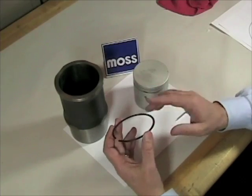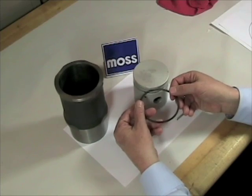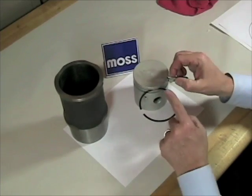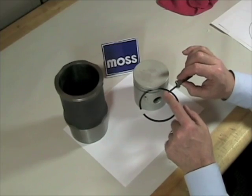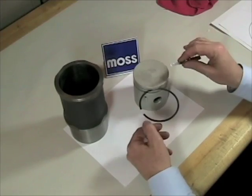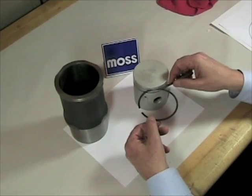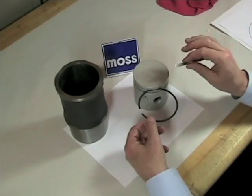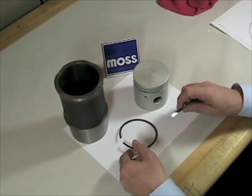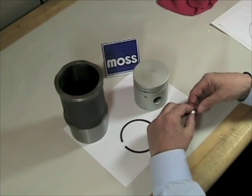Once we've got all that sorted out, the last thing we need to do is stick one of the rings into one of its grooves. We need to find in our shop manual what the ring groove clearance is, and go ahead and set a feeler gauge to that. We're going to feel to make sure that the ring groove clearance — the little bit of space left between the ring and the groove — is not beyond specifications. When it is within spec, we can move on to the next step, which is in our next video, and that's called Ring Gap.